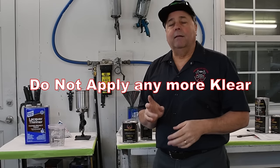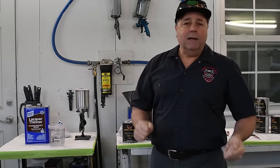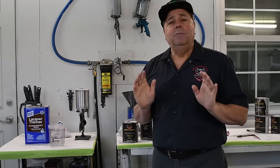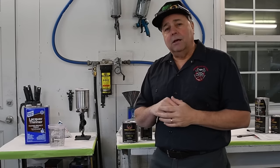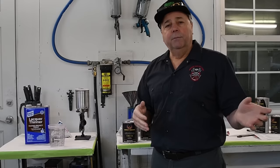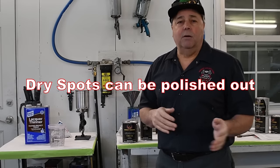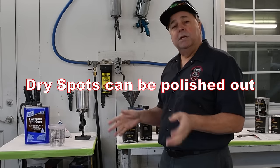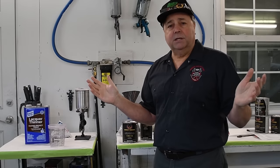People go back and they're like, well, this looks a little dry here, there, and they start shooting little spots and stuff. Don't do that, because what's gonna happen is you're gonna put too much paint in that area and you're gonna end up with a sag or a run and you're gonna regret it. You're better off to have a little bit of a dry area and you can come back, you can sand it, polish it out, and it'll be fine. So then once you're done, clean your gun out with lacquer thinner, and the project is complete.